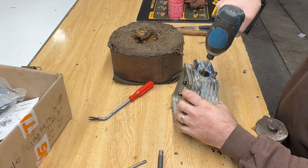After trying to find cylinder heads, well, guess what? Kohler's cylinder heads are different from 18 to 20, 22 to 23 horse, and then this is a 25 block, different cylinder heads. I had two and they were garbage, so had to end up fixing this one. Had to end up drilling it out a little deeper, tapping it, and trying to find longer metric screws. Anyway, it's fixed now, and it's back together. It got a little heated in here, so I wasn't really filming much.